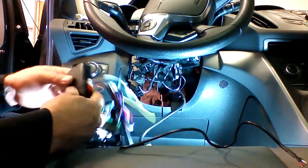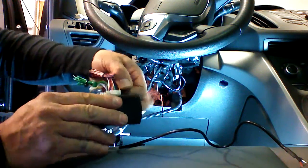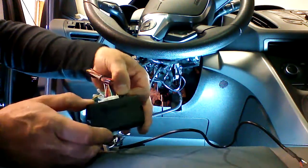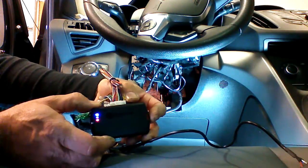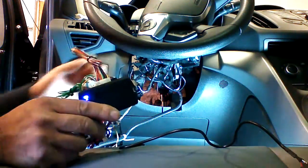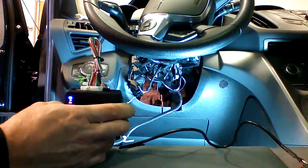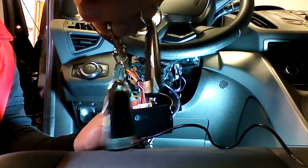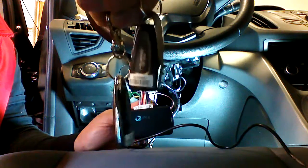This is going to make a connection between the long-range antenna and the Evo All. Now we can begin programming the long-range antenna. To begin programming, pull the four-pin plug. Hold the program button down while plugging in the four-pin, then release when the blue and the red LED are lit. The long-range antenna comes with two single-button remotes that work from up to 1,500 feet away.